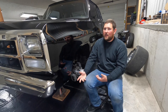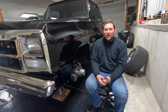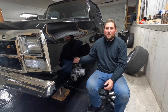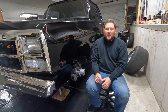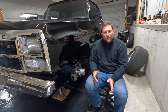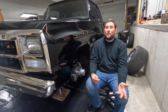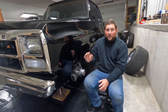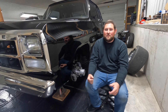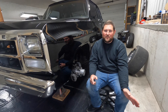There are just a lot more pros than cons going the manual steering route. The big factor I always consider is weight — this is definitely going to be a lighter option. I'm actually going to be using an aluminum steering box. Between getting away from the power steering pump, lines, and fluid, I'm guessing this will be around 25 to 30 pounds of weight savings. The power steering pumps have weight, the old gearboxes are cast iron and pretty heavy. We're going to weigh everything before and after. This is going to take a few days — we'll need to fabricate some mounts.